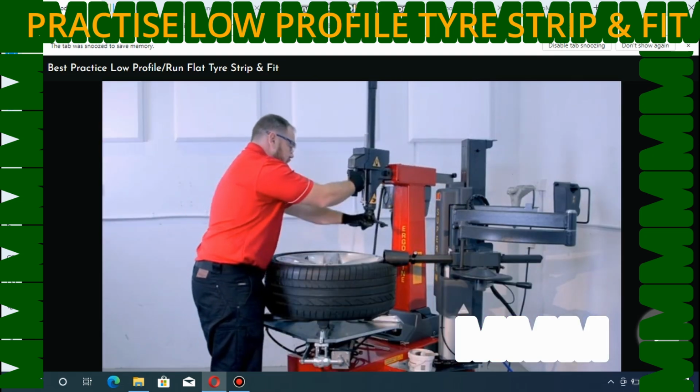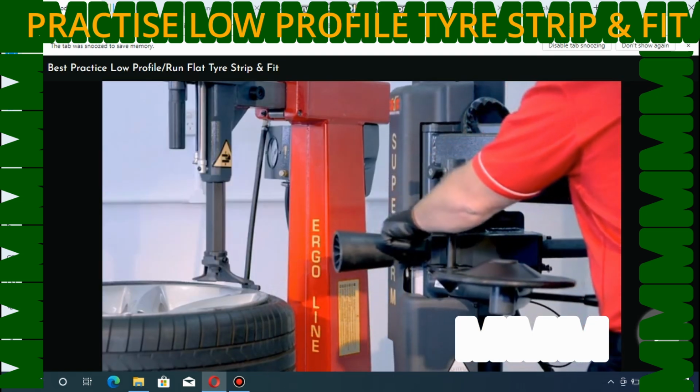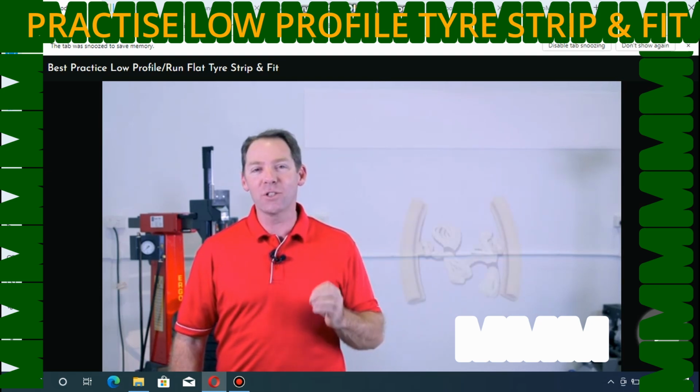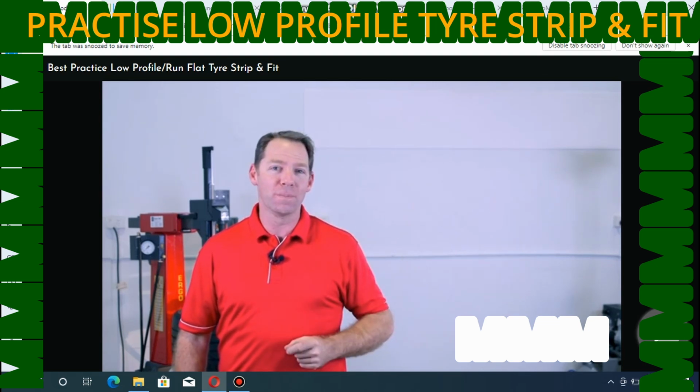Bring the tilt arm forward and position the foot as normal. Return the multifunction roller to its home position. If the tyre is really tight, it's a good idea to use additional rim protectors as the arm and foot will flex under extreme loads.